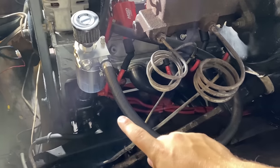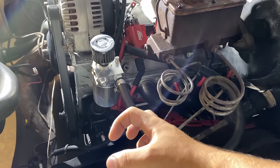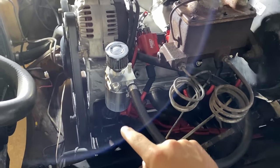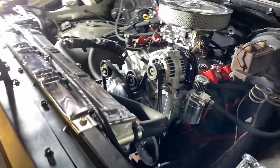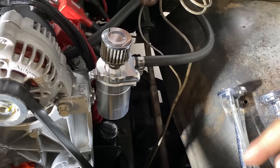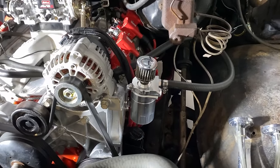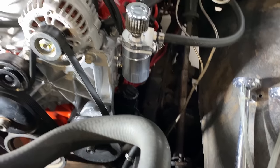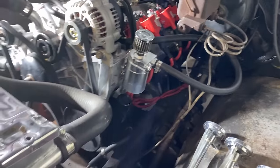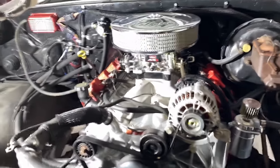There's a barb in the back of the power steering pump where the pressure line goes in. There's a one-inch barb that comes out of the newer style pumps and the older style pumps, and you can swap those. The newer style ones have an O-ring flared line — you can take that barb out of the back of the new pump, put your old power steering pump barb in, and then run a factory '74 C10 power steering line with no problems.